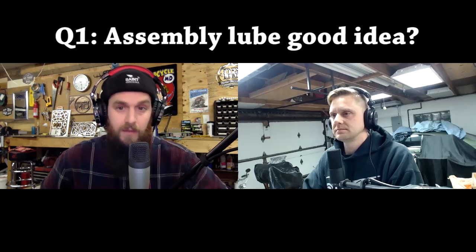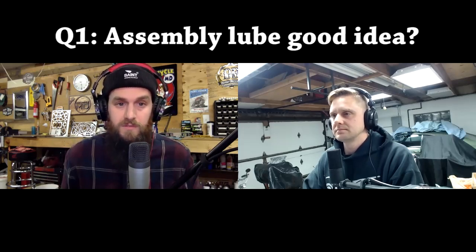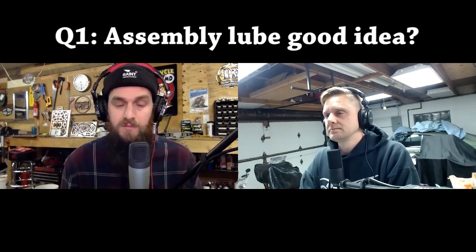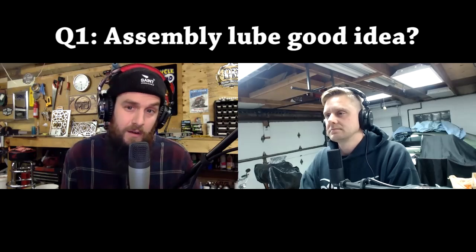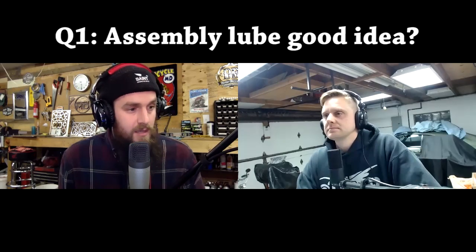If you know anything about motors, you know that the biggest time it's getting worn in is on startups, on cold startups, on fresh rebuilds, that first initial and those next couple of initial startups. I mean, all startups. That's the hardest part of the motor because there's not oil where it belongs. It's there, but it's not there as in while the motor's running and pressure is being applied.